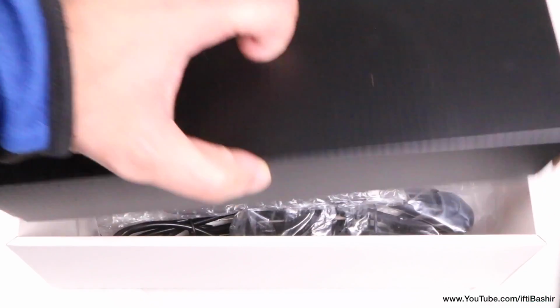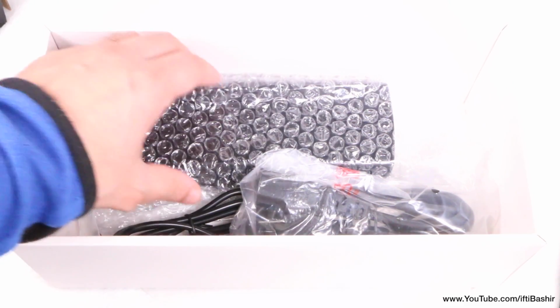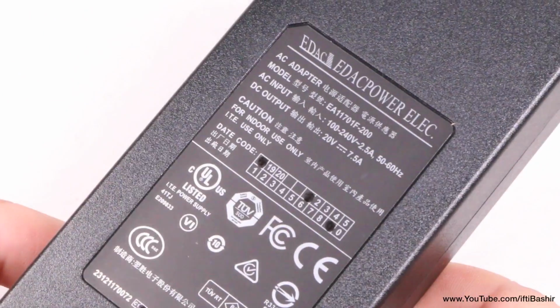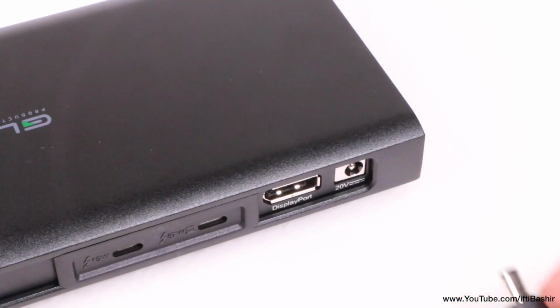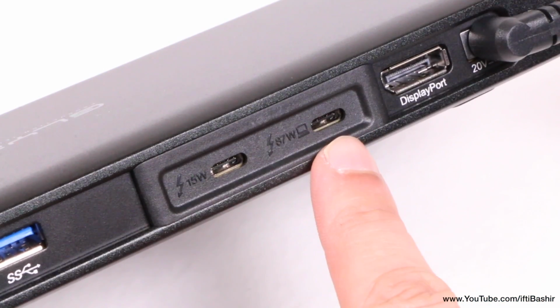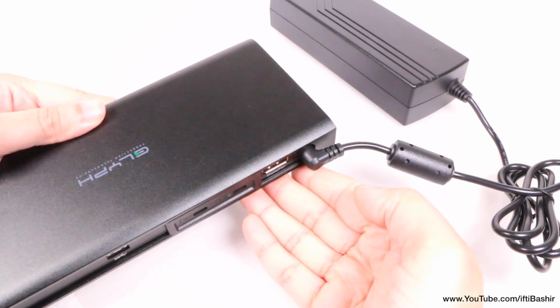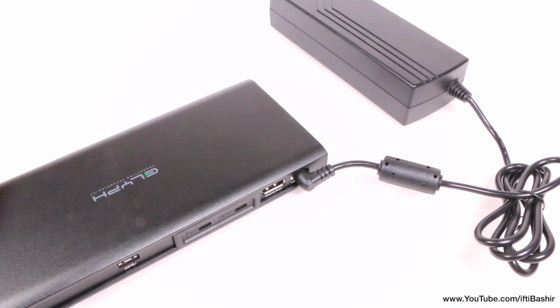As with all other Thunderbolt 3 docks, power is supplied by way of a rather large power brick, so you'll need to find some space behind your desk to store this thing. But it does provide power through to any peripherals connected to any of its ports, as well as 87 watts of power delivery to your connected computer through one of the two Thunderbolt 3 ports. That's enough for the MacBook Pro 15, but falls just short of the requirements of Apple's newest 16-inch MacBook, although enough to keep it topped up under most standard usage.